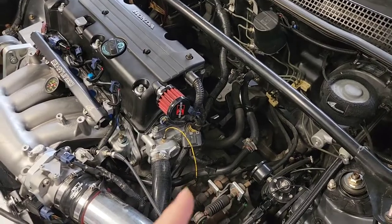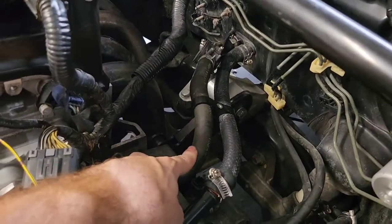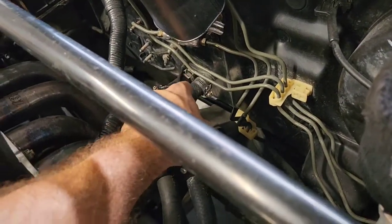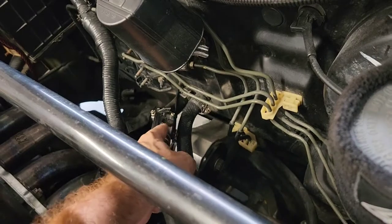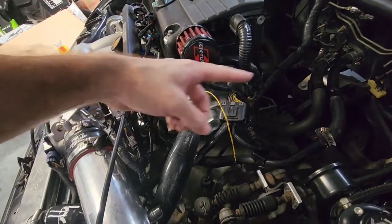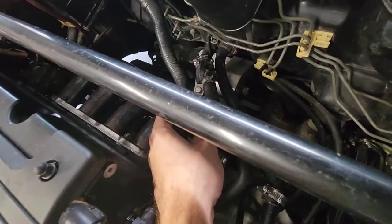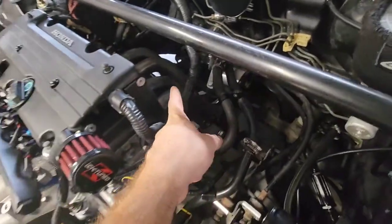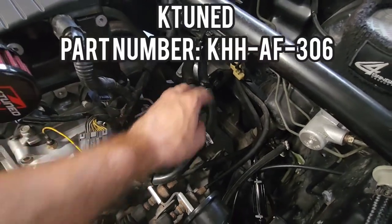In this segment, I'm going to talk about if you're keeping your heater hose for your K-swap — what to do. This here is from the original chassis, from the EG, the old engine. That one is when it had the bracket and it was on the firewall — I just modified it and cut it. What I did was I flipped it to the other side, as you can tell from the screw. I have it engaging like that, and I pretty much clocked it this way with the side-exit water outlet. It allows you to clock it, so it helps you a lot. As you can tell, it's much farther away from the headers than before. And then this is from the K-Tune universal kit — I just managed to use that.